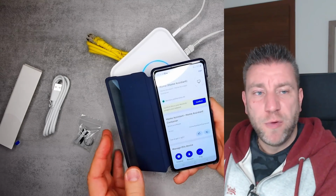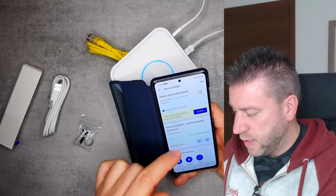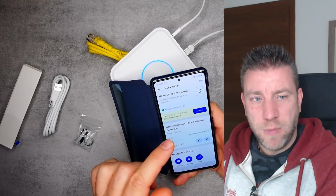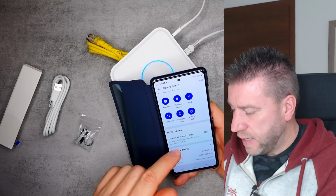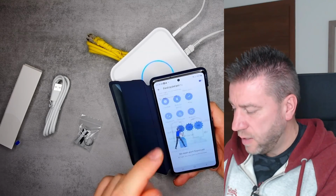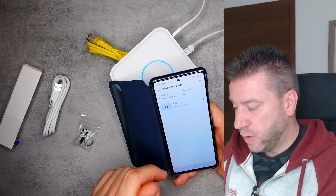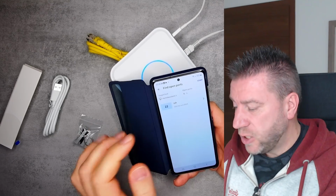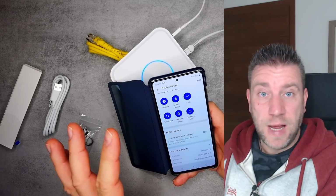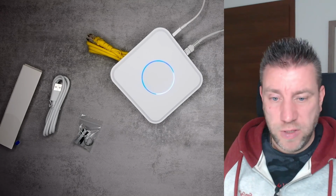And let me show you on my phone. So I'm scanning my home network and I found this device which actually says Home Assistant. So I think the host name is actually Home Assistant. And that's the IP, 176. And if I do a port scan, then I can see that SSH is enabled by default. Obviously it doesn't have a screen, so the only way to connect to this machine is over SSH. And as I said, I did turn this machine on, but I didn't make any changes to it. So this is how it was delivered and how I received it.